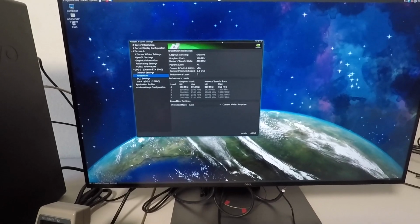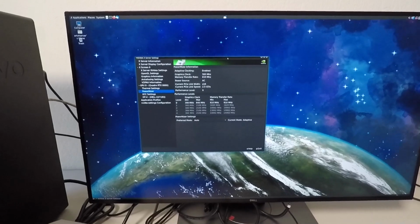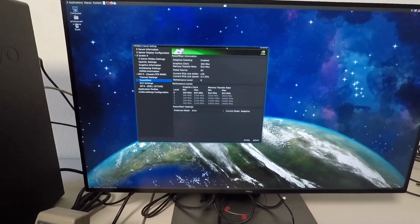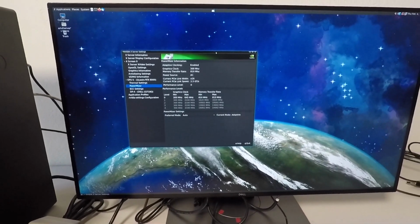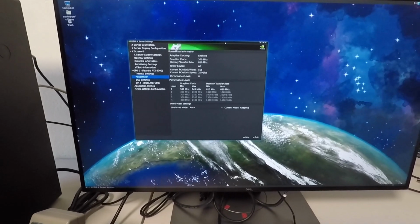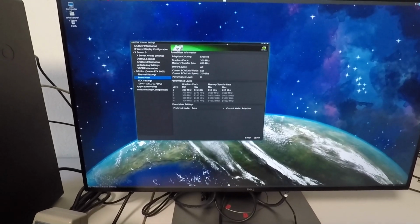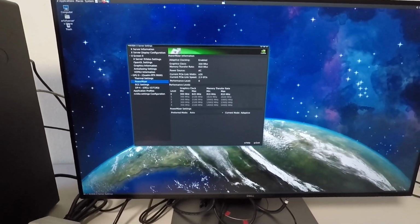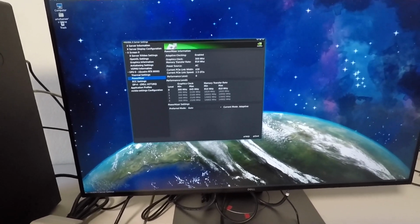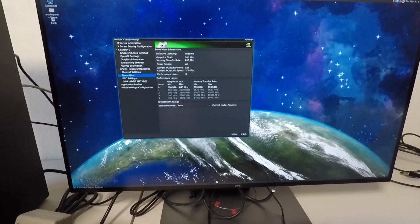In the next videos, I'm going to run some benchmarks, and by the way, in the first video you saw that we only had 2 DIMMs in this machine. I contacted Lenovo and I said, hey, this machine being an 8-channel CPU, wouldn't it be better if we had more memory? And so they sent me some memory. So now we actually have 128 gigabytes of memory with 16 gigabyte DIMMs in all channels. And so I'm going to run the benchmarks next time with that memory installed, and then we're going to look at the storage subsystem.